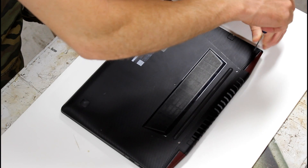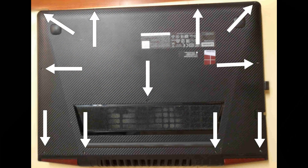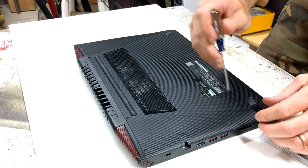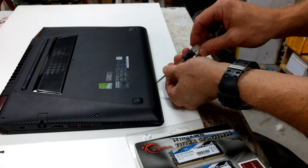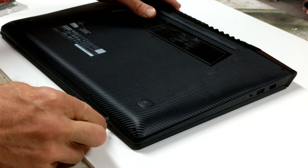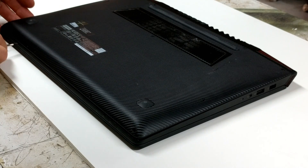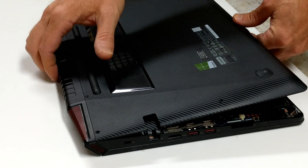Make sure the laptop's shut down and let's open up the case. Use a precision Phillips screwdriver to remove the 10 screws on the bottom. Just a heads up, the ones in the front are at a slight angle and not straight up and down like the other ones. Use a thin flathead screwdriver to pop the front open.